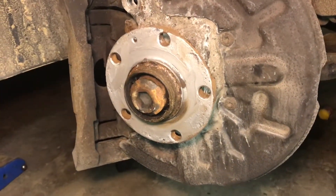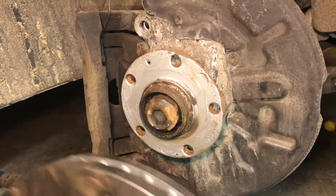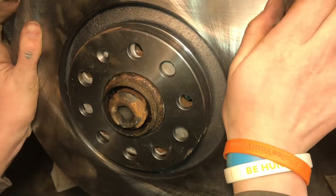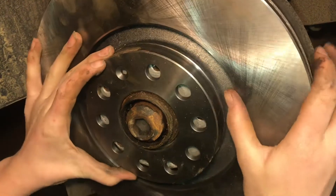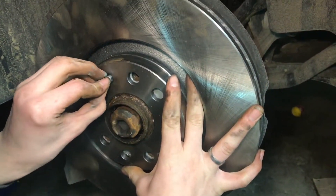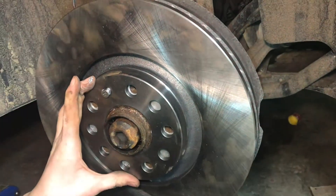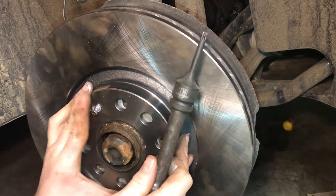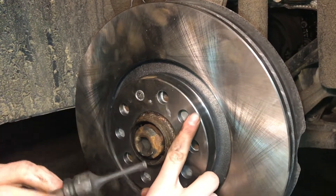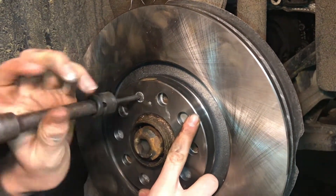One time we had it get so seized we had to try to pound it off with a sledgehammer, so this just makes it easier to come off next time. Go ahead and take the rotor, line the hole up, and lift it into place. To hold the rotor in place for the rest of the job, put the little screw back — make sure to put anti-seize on this screw as well, because when it gets frozen on there it can be really hard to get out and you don't want to strip it. Just make sure you don't get any anti-seize on the rotor itself, because you want your brakes to grip.